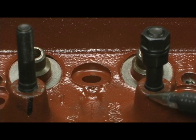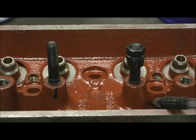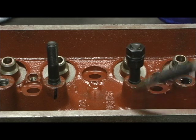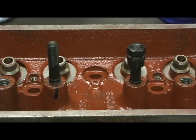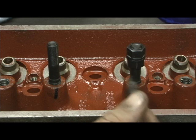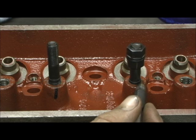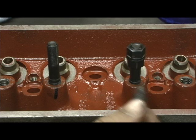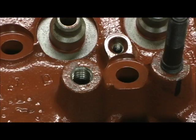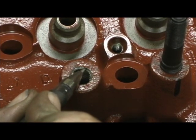The reason for this is you literally run out of room. When the head shop cuts the threads in there, it will touch the bottom and there's no more room to go. Pioneer made the studs long enough so for each application you can trim to fit. I trimmed a little over a hundred thousandths off — about two or three threads — to get it where it lays flush into the bevel. After threading, I took a countersink and hit the top to leave a bevel.